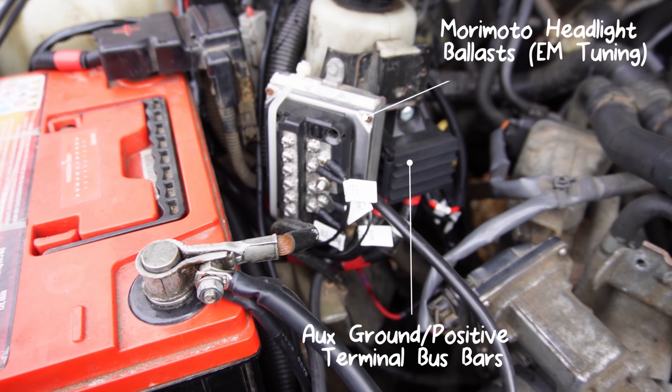4958 Stanton asked about my 12-volt system. I don't currently have one because I had a small fire in the back, which I'll cover in another video when I restore the truck bed. Before the fire I had a full Renogy system — a 50-amp split charger for solar and to run off the alternator while driving, and a 110-amp-hour Hankook deep-cycle calcium leisure battery. You only get about 55 amp hours of usable capacity from that lead-acid battery, which is why I want to move to lithium in the future. I also had an inverter, a 12-volt socket, USB ports, and a fuse/ground board.